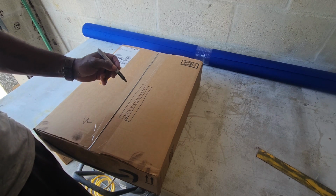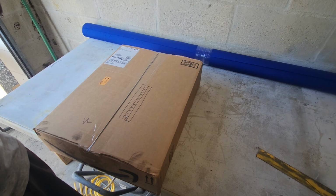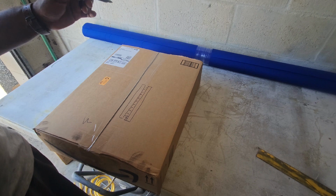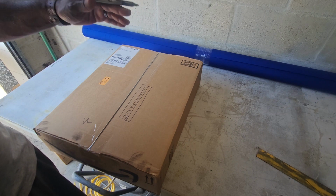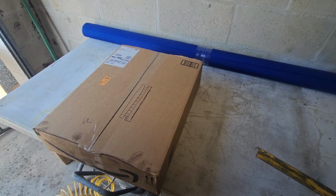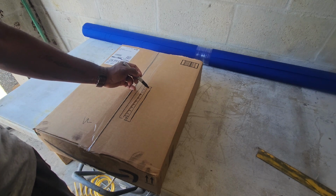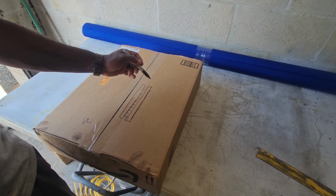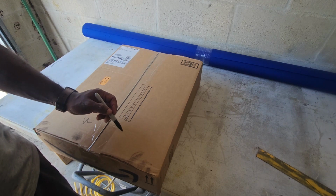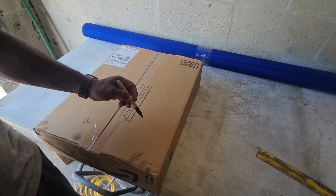Okay, and what happens is that when your rotors become warped, there's excessive heat unevenly distributed on the disc, and it causes the disc to become bent or wavy. If you've ever seen an old record that got a little too hot and it started to get wavy, that's what happens. So it ends up getting wavy, and then when you get your rotors turned, well, there's no way to fill in the low spots when you turn your rotors. What you do is you cut out the high spots. So you end up with a rotor where all areas are the same height, but there are areas that are thin, and then there are areas that are thick.